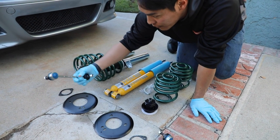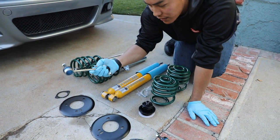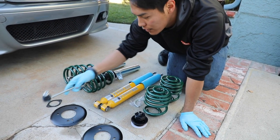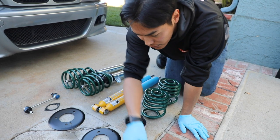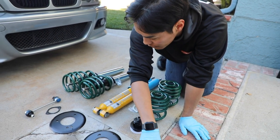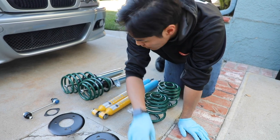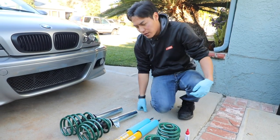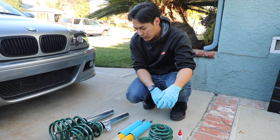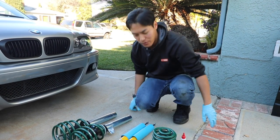And if you're going to ever drop these cars, you should always get shorter sway bar end links for the front. You don't want to use the stock ones because they're too long and they'll cause a lot of bind. So make sure you get the small, shorter ones. We'll link what part numbers these are down in the description below. But other than that, that's pretty much the gist of the kit. So now that we've explained that, it's time to get going and install this.